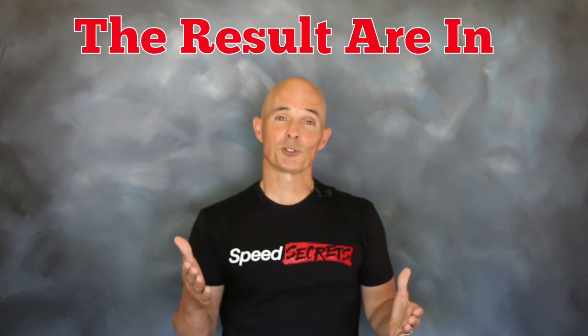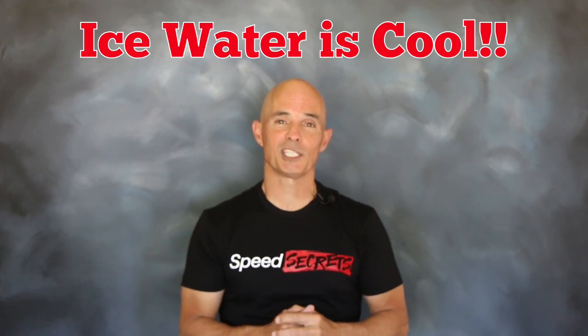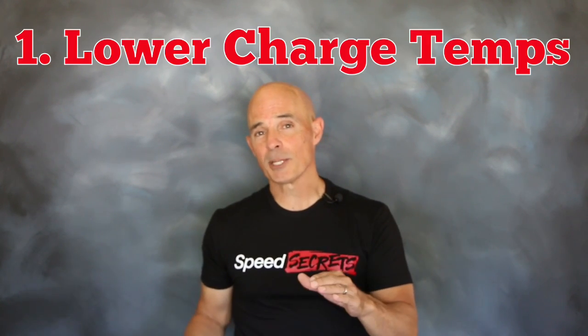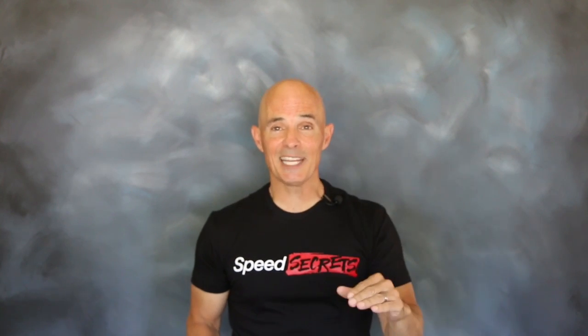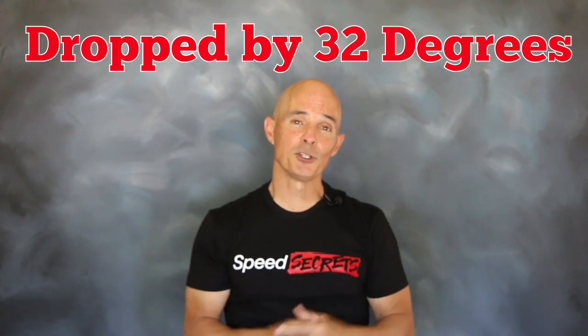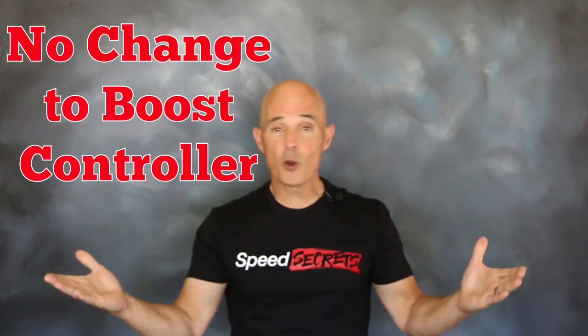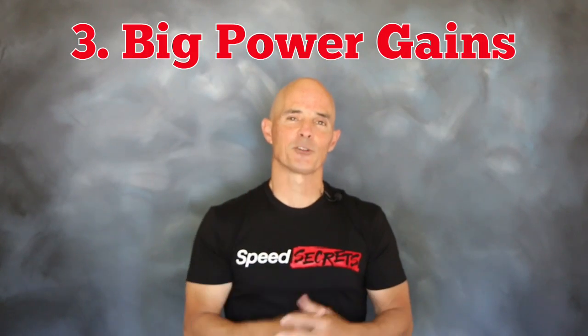The results are in and it looks like ice water is a real cool customer. We got three major changes during this test. Running with the ice water, the charge temperature dropped from 100 degrees down to 68 degrees — a change of 32 degrees in the manifold, which is a lot given the low boost level. The lower charge temperature actually increased the boost level by as much as one full pound, and we made no change to the manual wastegate controller — that was all from the change in temperature.